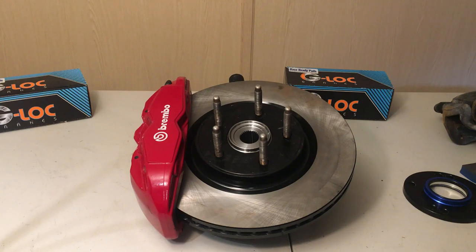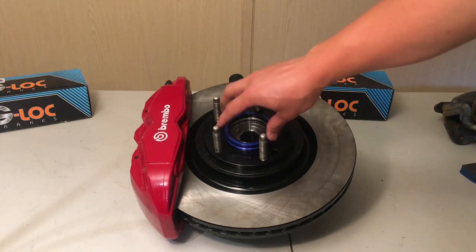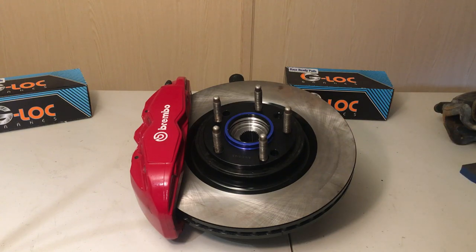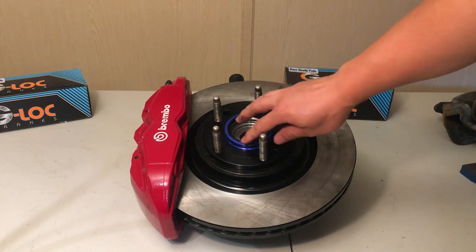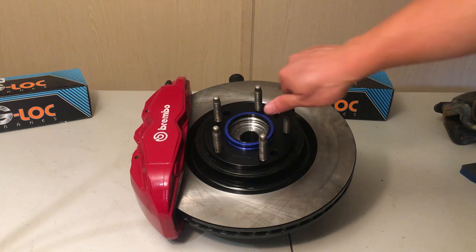Even if you have a barrel that is not stepped down, the next problem is spoke clearance. These Brembos are quite tall and the space from the wheel mounting hub to the calipers is pretty tight. So only specific wheels with lots of brake clearance will work. I'm opting for a 10mm hub-centric wheel spacer with a hub ring that converts from 64.1mm to 73.1mm for the wheels I'm getting.